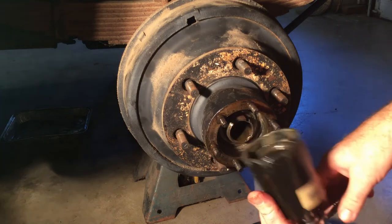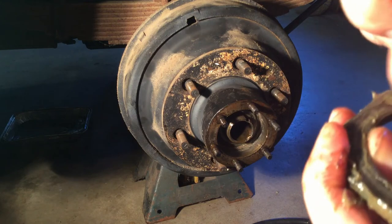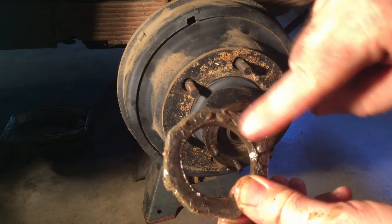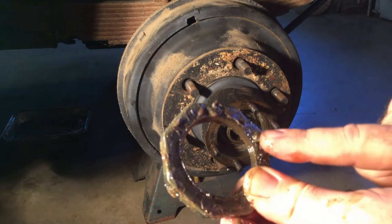This piece here is directional — one side is flat and the other side has a little protrusion. That lock ring has a hole in it that's going to sit in here and hold this from backing off.